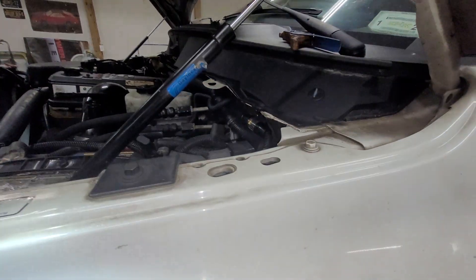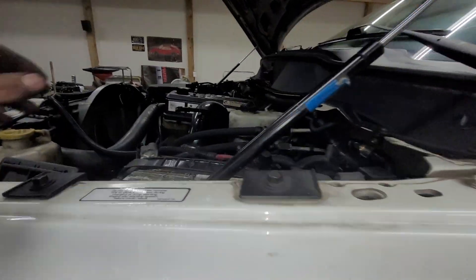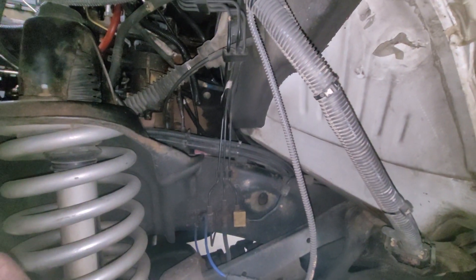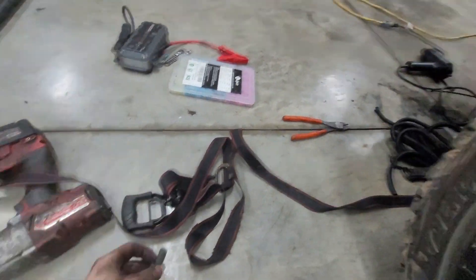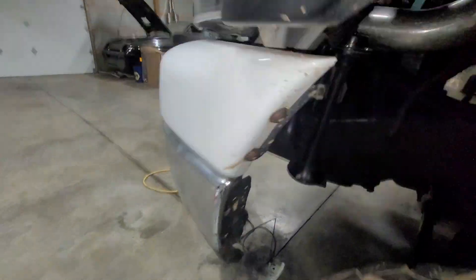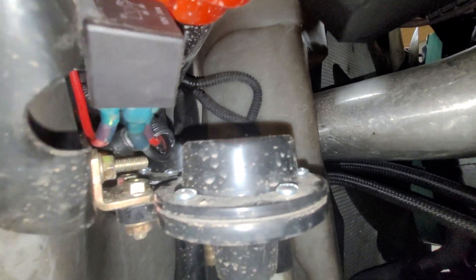This big bolt right here behind the starter — I undid the battery terminals because I did not trust myself not to smash the starter. That sucked the entire time. I ended up putting a 15 mil wrench on that bolt, ran it back behind that bracket, and ratchet strapped the whole thing to get it out. Also, the horn is done. We got everything nice and loomed — we have nice harnesses back here. I've also taken care of this headlight.